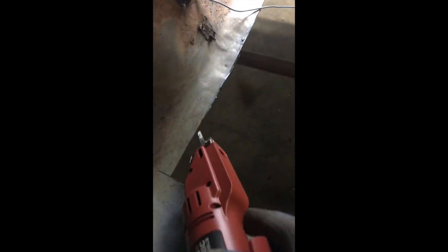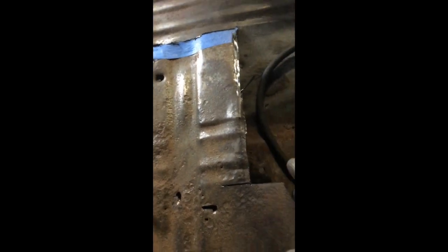This is how I started on the body — I decided to start with the floor and work up to ensure the foundation's good. I wish I had cut it a little straighter; it would have made welding easier. I used an angle grinder with a cutoff wheel and a reciprocating saw from Harbor Freight — good for getting into corners. I cut off everything that was soft and had holes in it, made straight lines with a permanent marker and went to town.